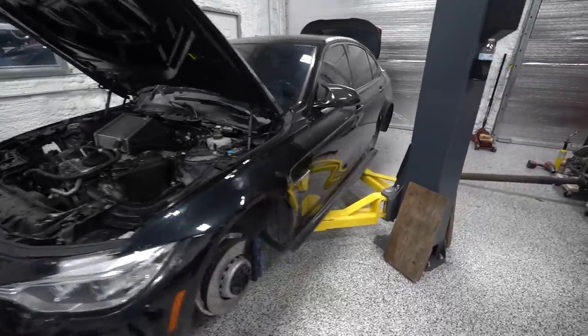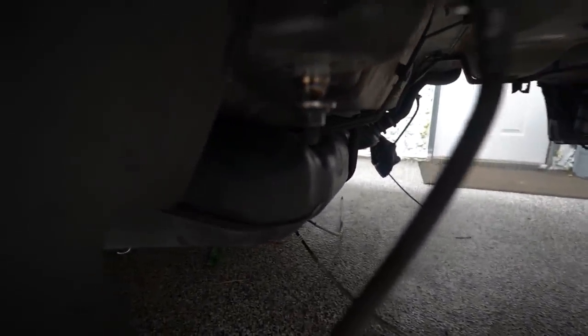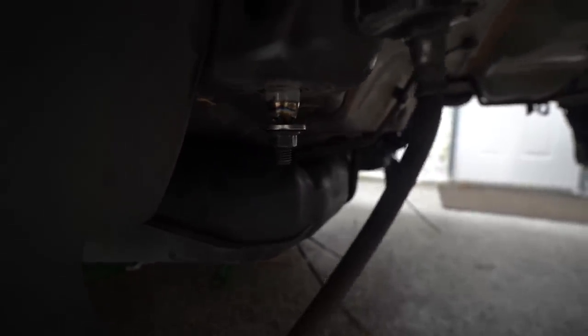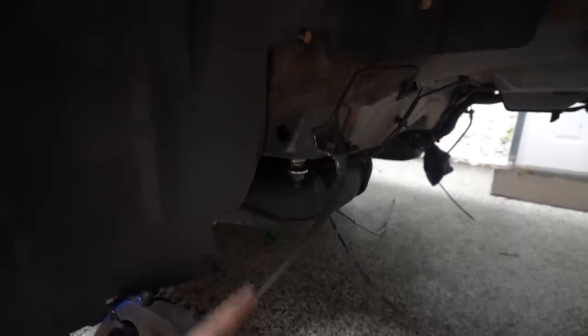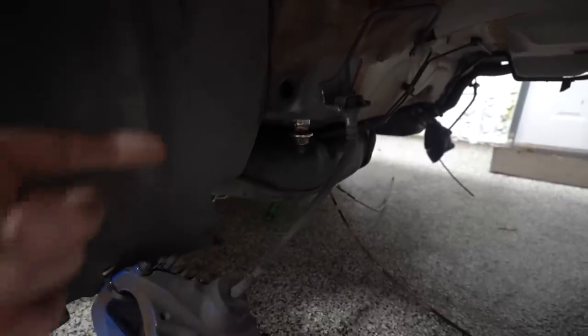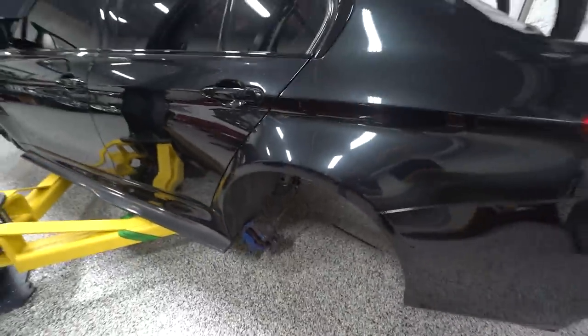We hooked everything back up, plugged everything back in — the door still says hood open, it beeps and makes the noises. I'm pretty happy with how this turned out all things considered. I am a little worried about bolt temper from the heat but I tried to keep it cool, weld in small portions, and never really got it red hot. The only other options were drilling it out and helicoiling, but I don't know if there's enough meat without getting into the walls, and past that you'd have to cut an access hole from the top to drop a stud down. Neither seemed like great options, so you've got to roll with the punches and do what you have to do when problems are presented.